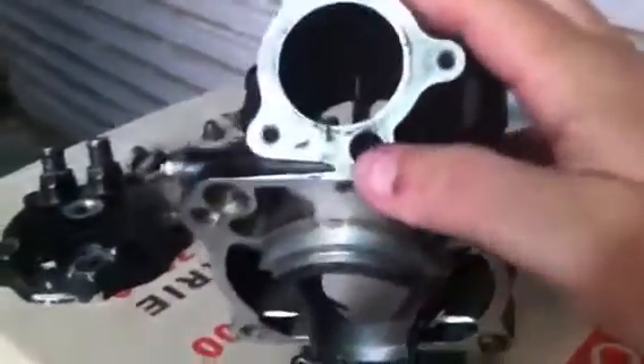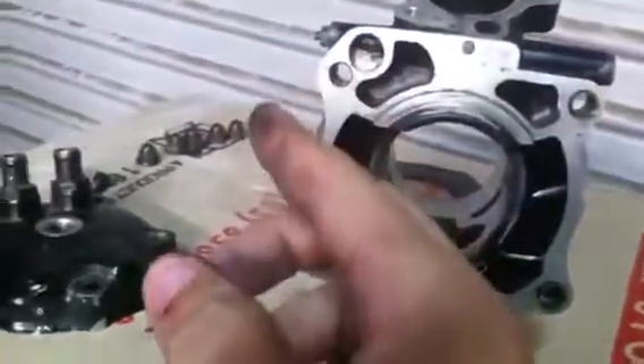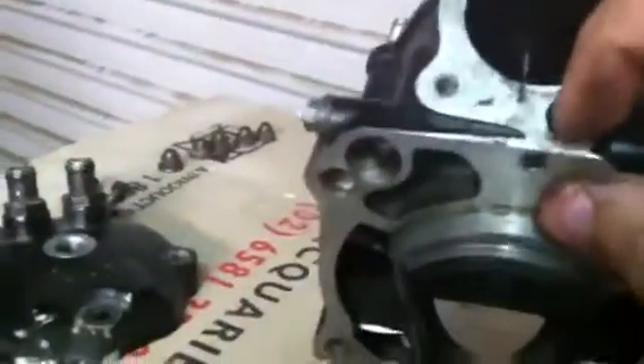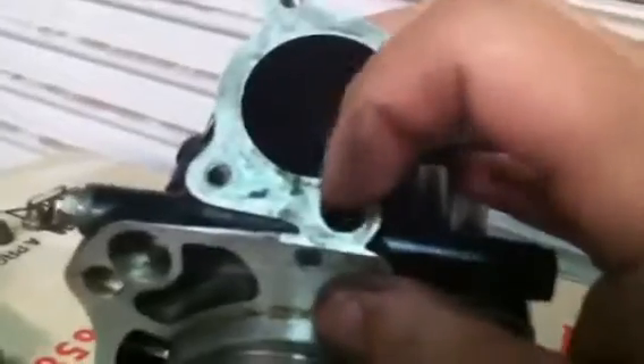It runs off a rack and pinion that runs through there. How it works is that in the gearbox behind the water pump there's a centrifugal actuator, which expands during the different RPMs. This then pushes against an actuating arm which goes up through the crankcase and sits in this gap here, and pushes on this rod here which has gear teeth sitting there, and has a spring back here to keep the tension on it.